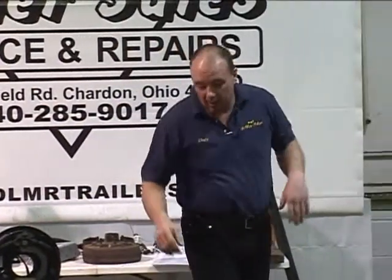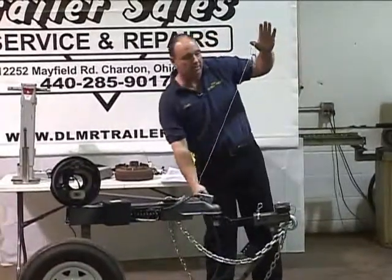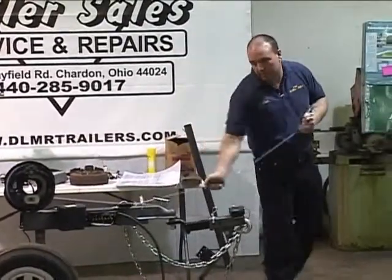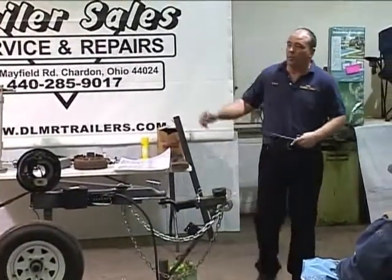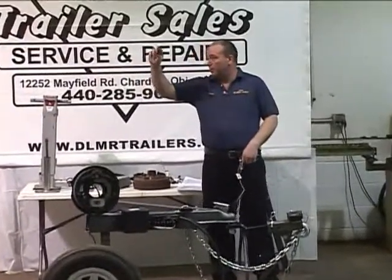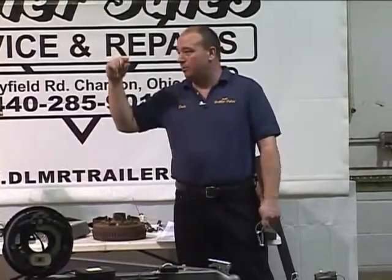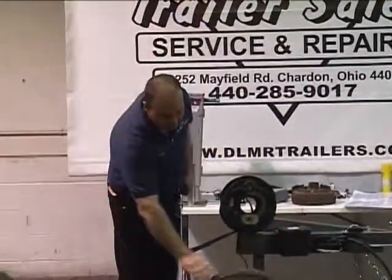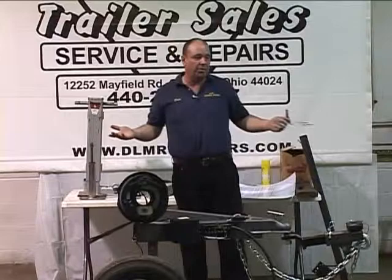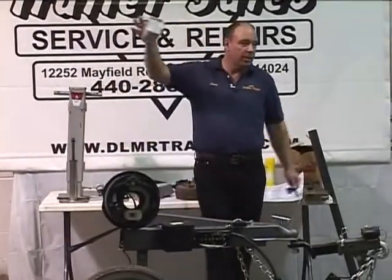How many people hook this breakaway cable up? How many people know what it does? Pull it out — and the more you pull this out, the better off you are. Water gets inside this little box; it's two little pieces of spring wire, and they collapse together and make the connection. If you leave this stuck in there and never pull it out, you'll pull it out someday and it's rusted — won't work. If I have this wired right, we're locked. The brakes are free. Pull this out, jump in your truck, move forward. If the wheels skid, your breakaway battery in this little box is charged and ready to go.